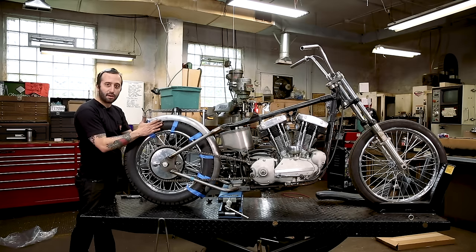So since the ruler fits inside here and I'm touching this edge and that edge, if you just make sure that the ruler is parallel to the edge of the plate, this is going to be perfectly centered on this plate. So we can actually just look off of these numbers. This is a 6-inch ruler. The 3 is the center, and we want the holes to be 1.5 inches from center to center. So you just divide that by 2, which is 3/4, and you can actually just move 3/4 in both directions, and we're at 1.5 inches. Not a bad idea to check it after you get it. That looks good to me.